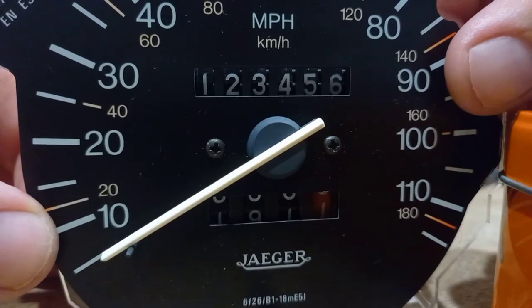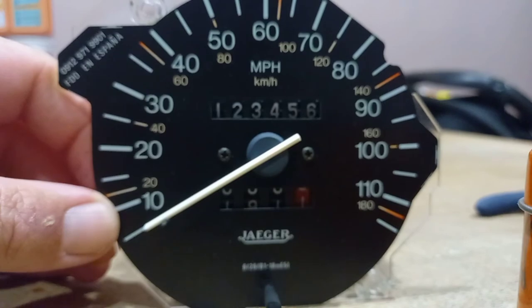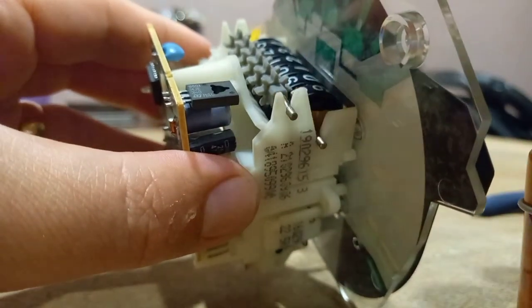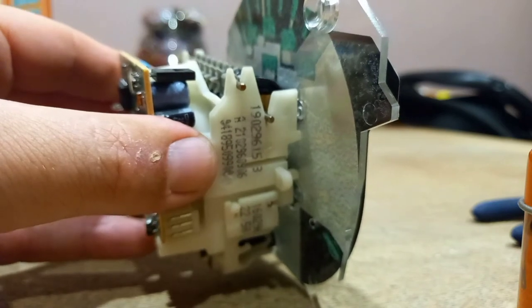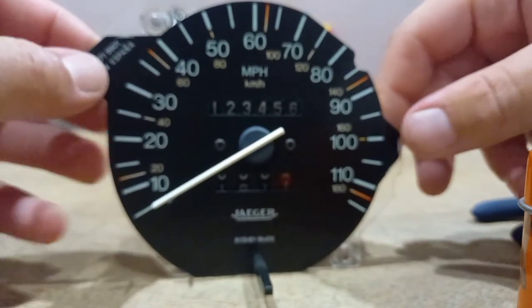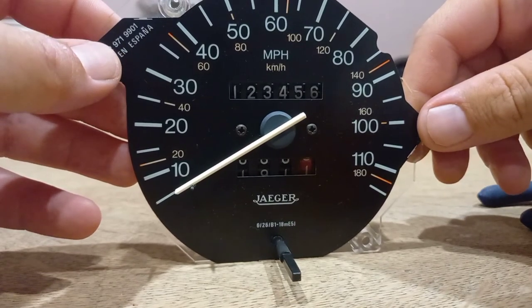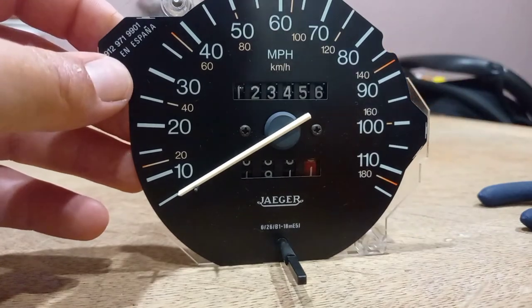So you can see I messed up the first time, but the second time the mileage is correct for our scenario. If you do muck it up the first time, just pop this bit off again, click the numbers round, and use a bit of force — perhaps use some long-nosed pliers or something like a screwdriver to pop the spindle back on again — and yeah, just fit it back to your clocks and you've adjusted your mileage. This one's a Citroën AX but I assume similar vehicles, at least old-style manual clocks, are fairly similar in the process of changing the mileage. So if you have a genuine reason to correct your mileage, I hope this video helps. Cheers guys!